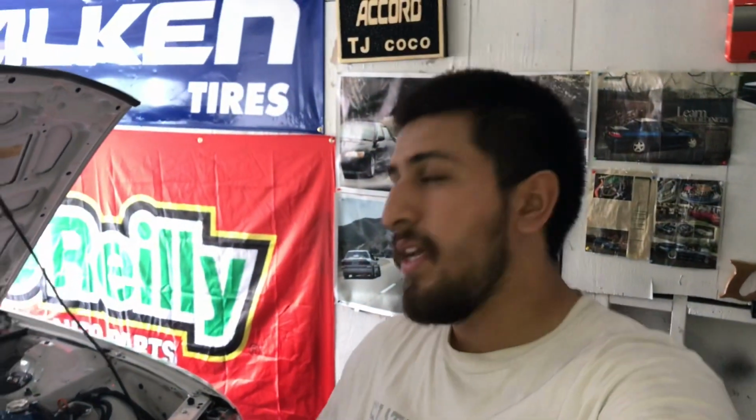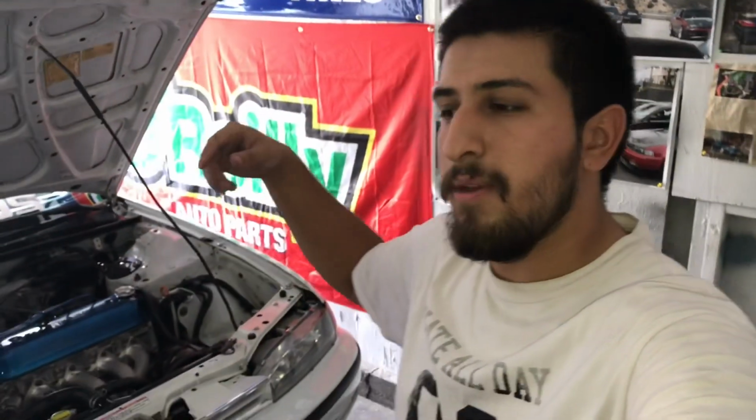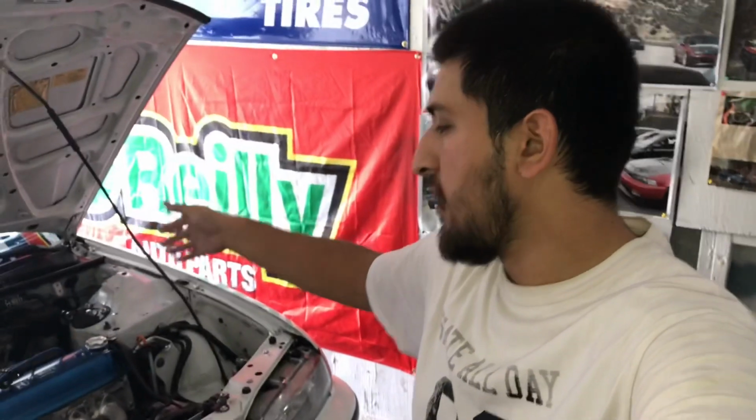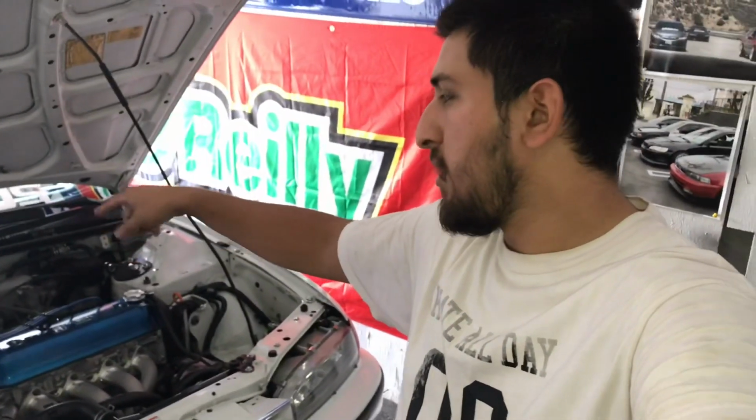Alrighty guys, and there you go. That is mission accomplished. We got the new thermostat in, refilled the system, let it run for a little bit. Basically the process after you do that is start up the car, let it get to temperature, and hopefully your new thermostat should open up and you'll feel this hose right here get nice and warm, and that'll let you know that it's working alright.